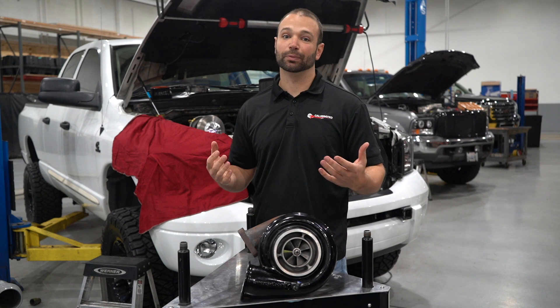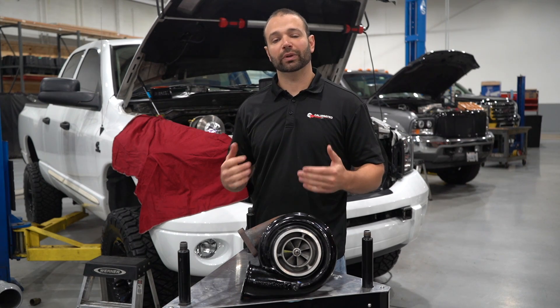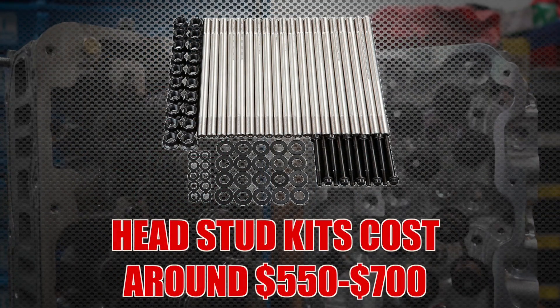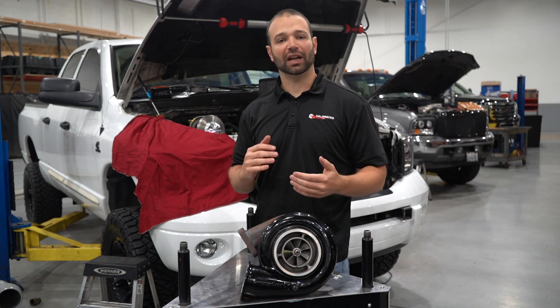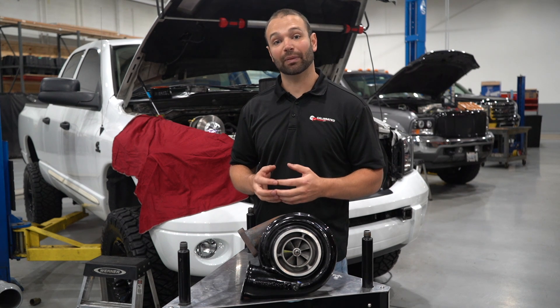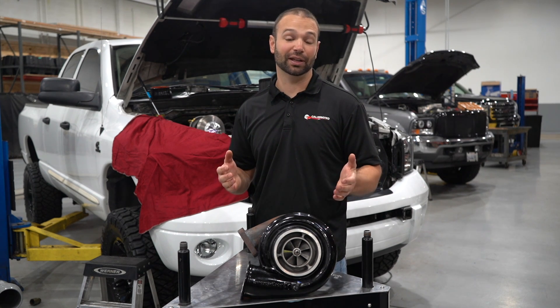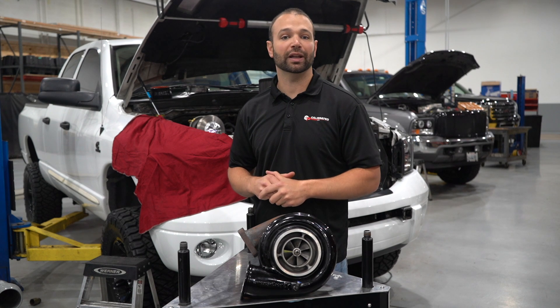As far as sizing your fuel system on a twin kit, that's really up to you. Your fueling is dictated by the power level you want to make — if that's below the ceiling of the twin kit, go for it. A big question we get with compound kits is: don't I need head studs? You'll always hear someone who put a compound kit on and blew the head gaskets day one. Typically, if you have a compound kit on the truck, you can safen up the timing curve and keep the truck running well within its designed power band. Higher boost means higher cylinder pressure, higher in-cylinder heat, and more potential to blow the head gaskets — true. But most guys have a really positive experience with a compound kit and get a long life out of their truck. It really depends on how you treat it.